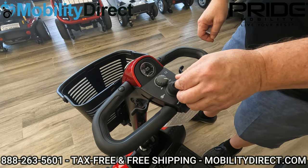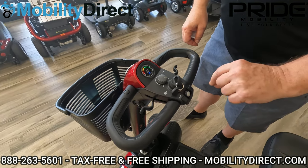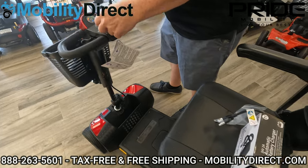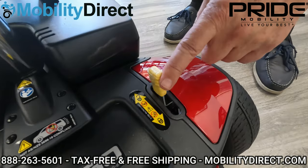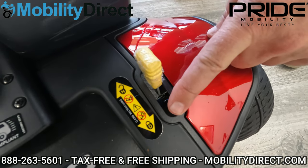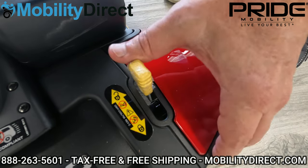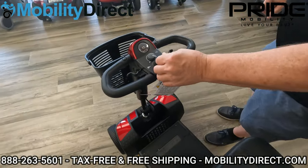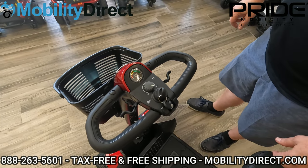We're going to get our key out to show you how the dash works — how to insert it and some of the basic functions. You can see on here there's a little bit of tape. We have two keys — always one big, one small. You drop it in with a little wiggle until it drops in. When you turn it on, there's a very common problem: if you hear beeping, that means you have not engaged the motors in back or the brakes have been disengaged. The yellow handle needs to be in drive — flip it back to the lock position and when you turn the key on, you'll see a full battery with no beeping.